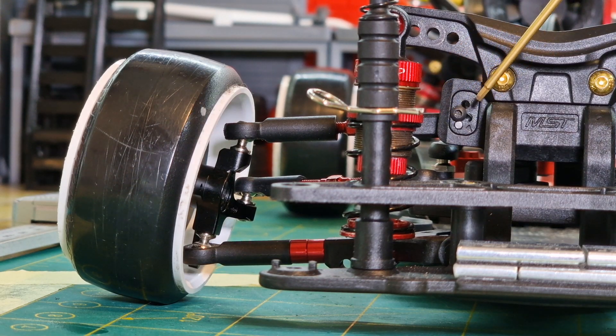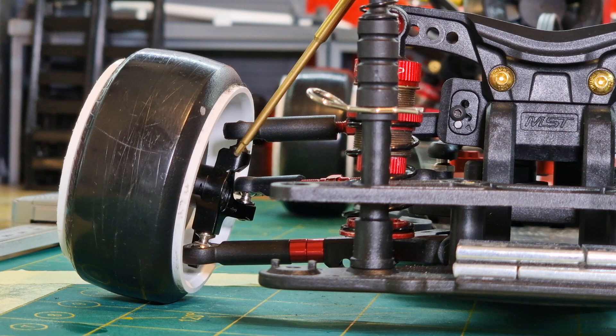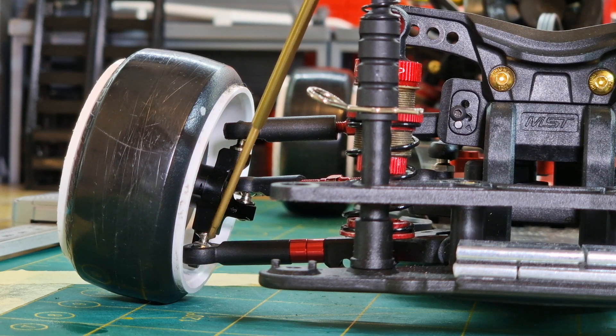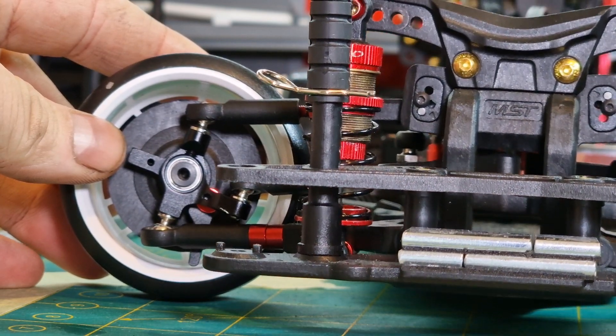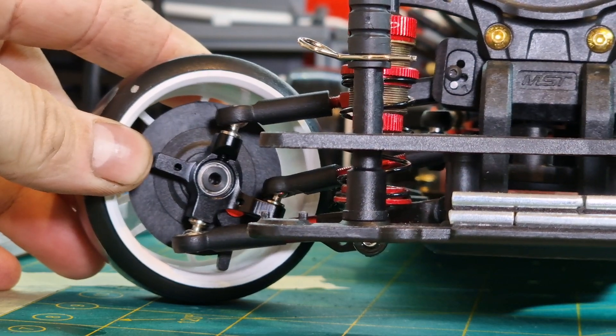The final thing I want to address in this video is moving the upper arm mounting point from here up to here. We can do this by taking the front block and moving it to the back of the arm, and moving the back block to the front of the arm. This will move the top arm mounting point about 5mm up, and then to compensate we can put a 2mm spacer between the hub and the ball end here, and a 2mm spacer between the hub and the ball end here. With the arm twisted out like so, when the suspension raises we've only got a small amount until it hits, or if we're already at full droop the arm is going to hit on the hub.